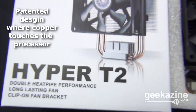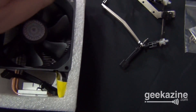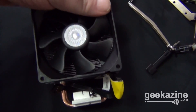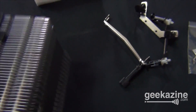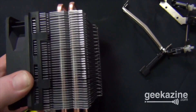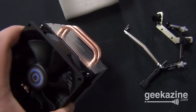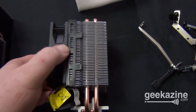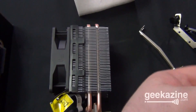This is a simple unboxing. We've got the fan here, which I'll pull out really quick. As you can see, we've got the heat sinks. This end right here is what is going to sit on top of the processor. And of course it's got a fan. The cool thing is on the other side you can clip another fan on if you need to. It's a standard heat sink processor, a little bit bigger than the one inside my machine. It's not liquid cooled — it's all fan cooled. The fan's going to push the heat this way, so you want it oriented so the heat goes out of the computer.